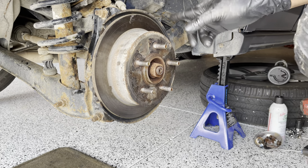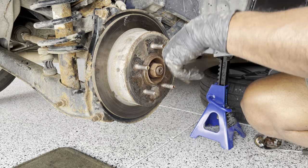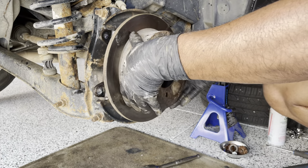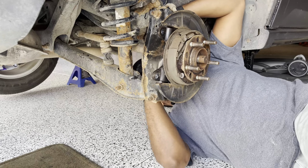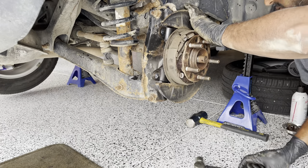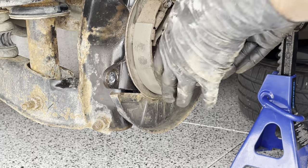Now that I have loosened all four bolts at the back, it's time to remove the disc. A couple of taps and the disc is out. Now I'm going to remove all four bolts and give it a small tap so the hub can come out. Before removing the last bolt, I leave it slightly in, place a socket on it, and hammer it. Then I use the socket and extension and hammer it so we can take it out.